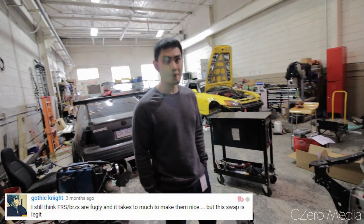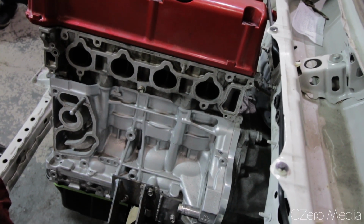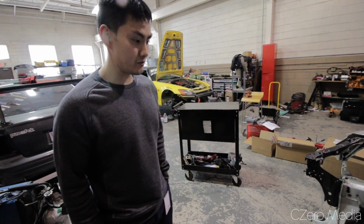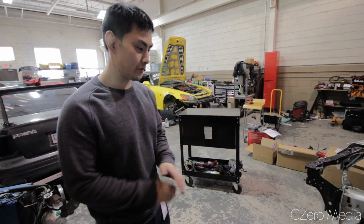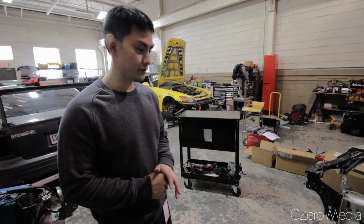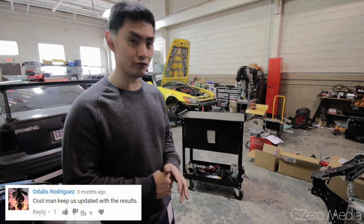So did you have to cut out the transmission tunnel or anything like that? It just directly fit in there? Yeah. Oh, that's nice. Did you have to do something innovative with the oil pan? Yeah, I had to basically cut the oil pan in half to clear the subframe. It's not completely finished now, and the oil pickup for the oiling system is unmodified. So basically, I just have to finish up the design on it. I may have a final design in the next video update, so look forward to that.